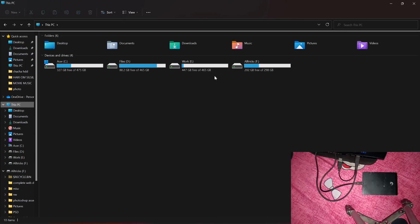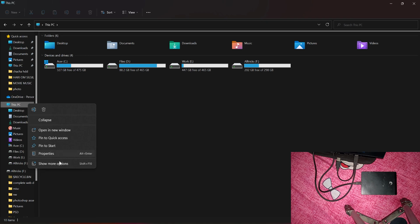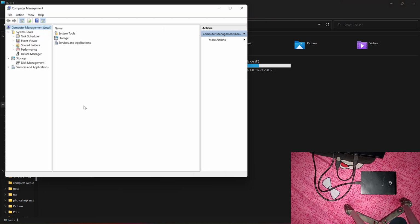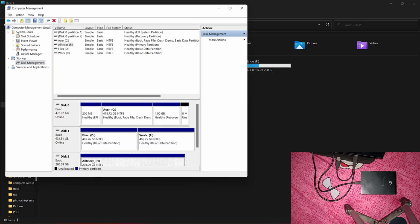On our PC, we have to launch Explorer. We can see the drive is there under This PC. And now I will launch Disk Management from the Manage section. I will go to the Disk Management system from Computer Management. If you see, Disk 2 is my hard disk. You can see I have right-clicked and gone to the properties of the disk.